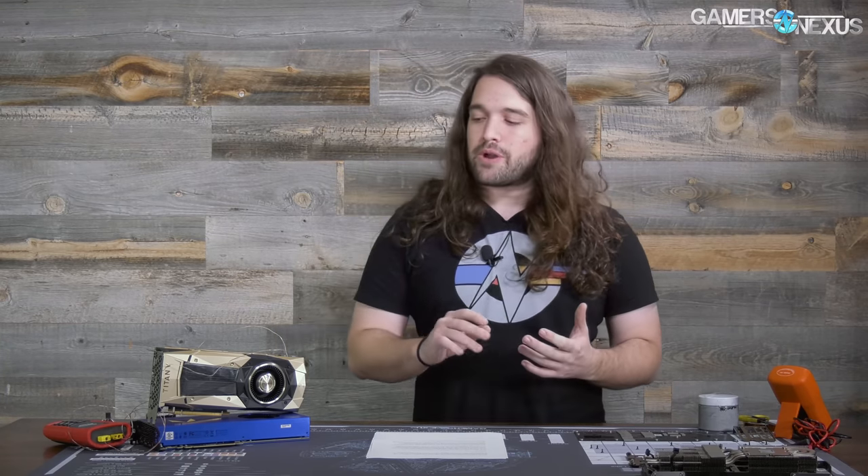So it's got a whole lot of room — it's really easy to push the card pretty far with a 200 MHz core and HBM overclock — and it's just being choked by this cooler, which is unfortunate. It comes back to the question at the beginning of the video: when do you actually want this cooler as a legitimate user of this card? For cards that aren't this, like the 10-series, you might want a cooler like this if you're a system integrator and you want something you can roll out, repair, and service easily in poorly-maintained environments.